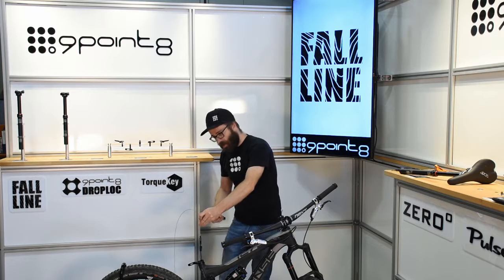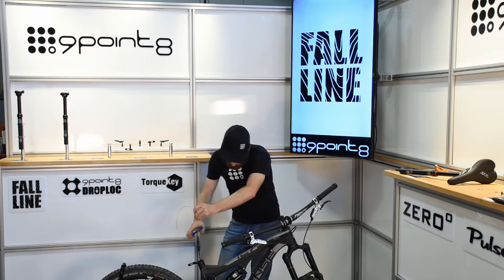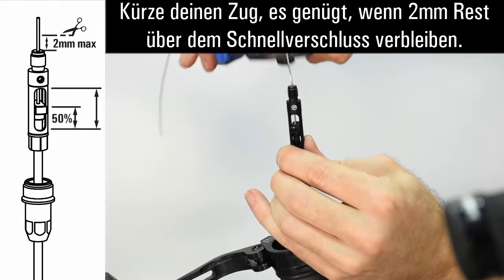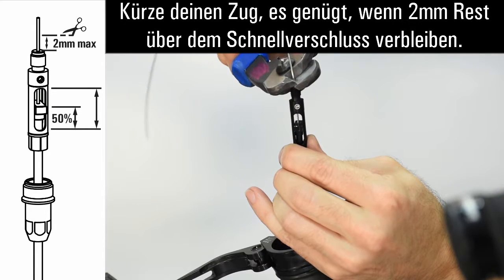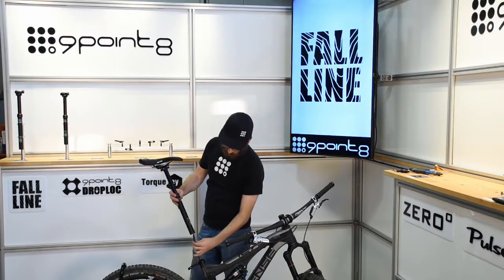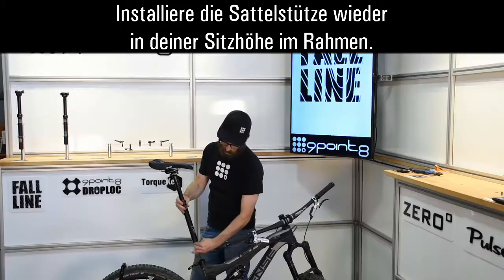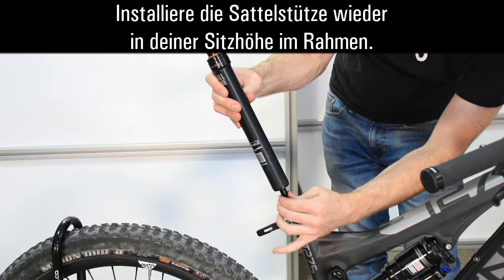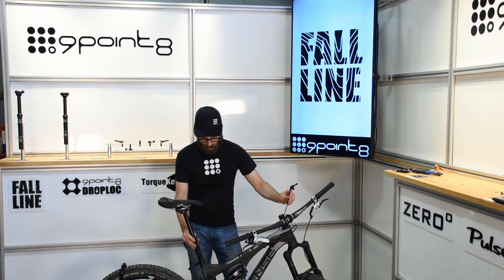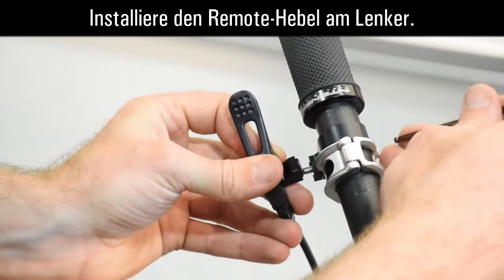This cable has got to be cut off pretty tight to the top of the quick connect. Before you cut the cable, do a double check and make sure that you're in position and everything's good. Then snip it off. You can reinstall your post: quick connect goes in the bottom, spin your post onto the quick connect, then your cable seal nut threads up into the bottom. Slide the post into the seat tube.